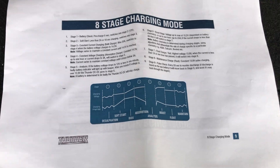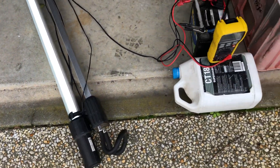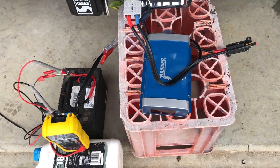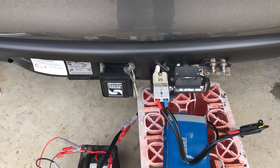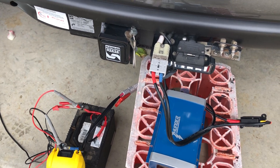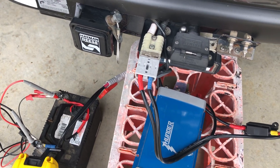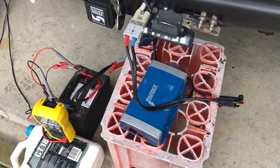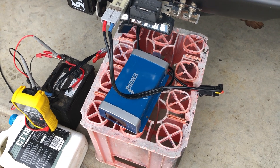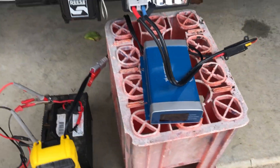It's eight-stage charging, so we'll see what happens. This is the little setup I've got - a workshop light hooked up to a little lead acid battery there, a DC-DC charger coming out of the back of the Anderson plug. I've got the smart charger disconnected on the car so I easily get over 14 volts at that plug - probably 14.2 to 14.4 volts coming from the engine when I start it.